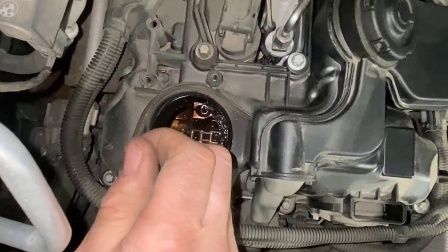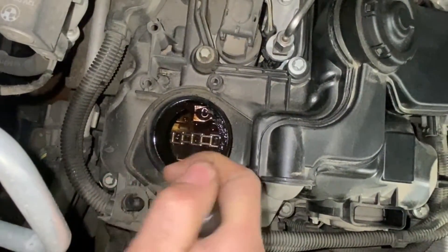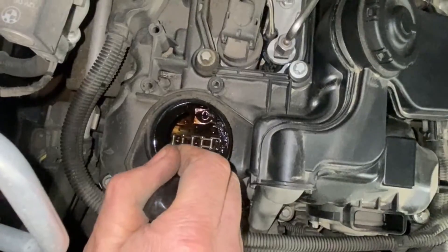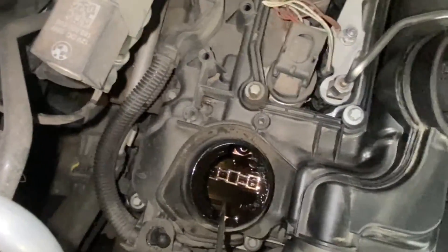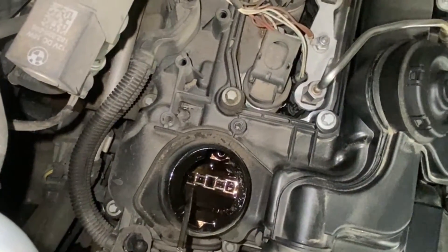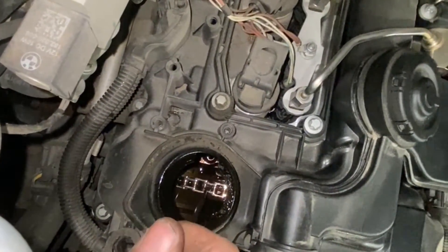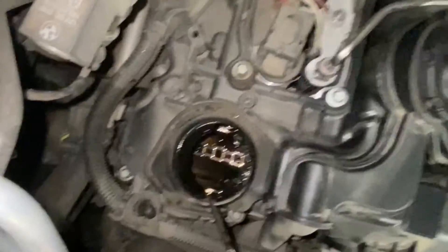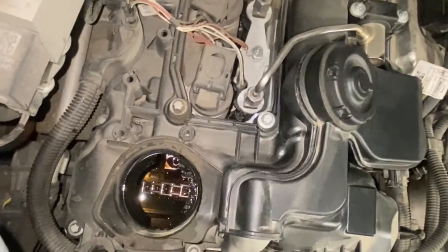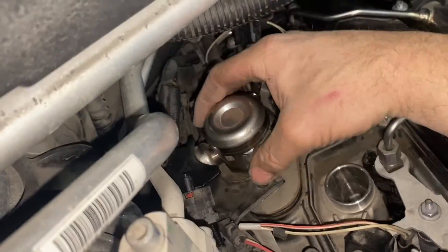This chain — before when I first looked at it you could literally lift it nearly one inch. But you can have really loose chains in between strokes — that's just the way these four-cylinder engines work. It doesn't necessarily mean the chain is worn or stretched, but in this case I think it is. Time will tell — we'll have to whip that off.